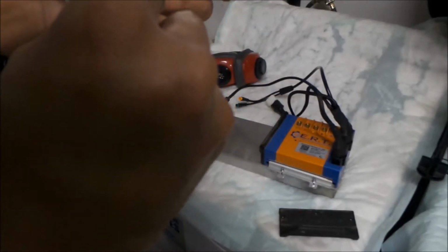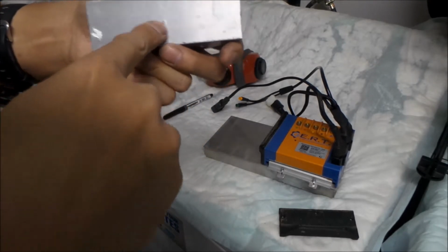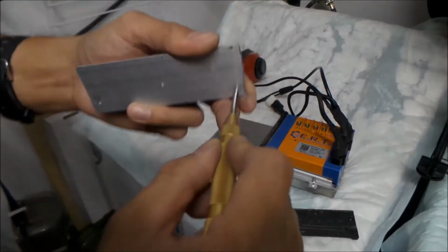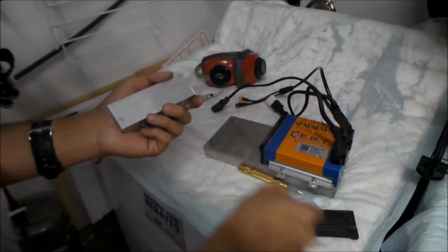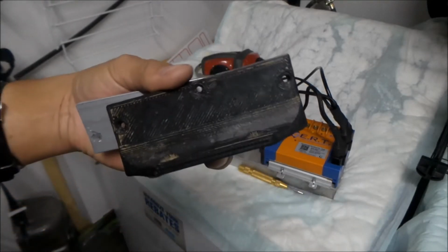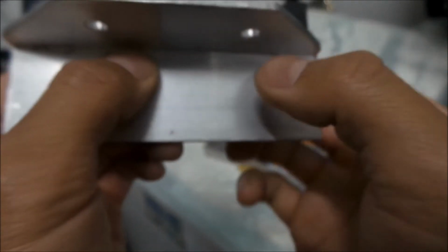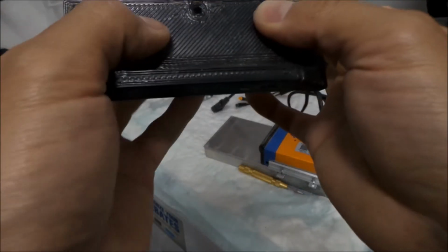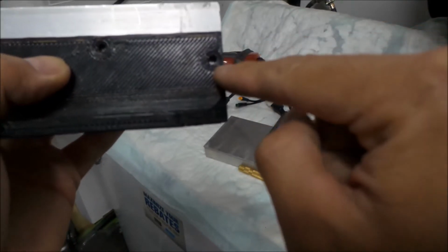This one we're going to punch a little bit lower. Okay, we're going to make sure we drill the bottom hole on that bottom dimple on that one. Okay, there's one other dimple. Boom. Okay, spring loaded. All right. So now we're going to go find a drill bit that fits that. I think we should just use a drill bit instead of a step bit. I'm just going to double check one more time where we're at. Okay, it looks a little bit crooked. Back a little bit. I mean, we can make the holes a little bit bigger so there's a little bit of room for play, you know, but it looks good I think as long as we can see the dimple inside the hole.